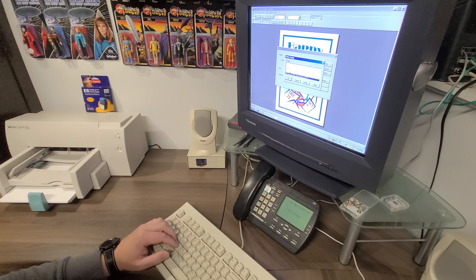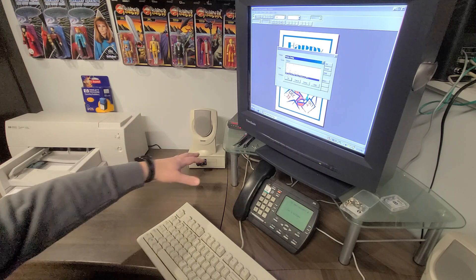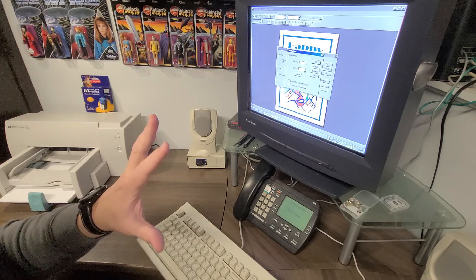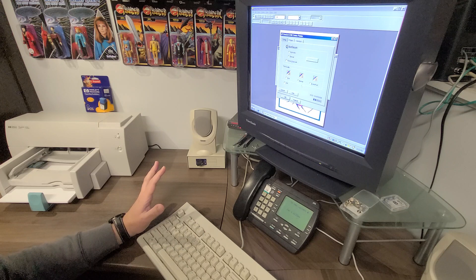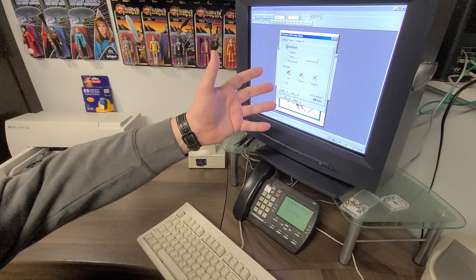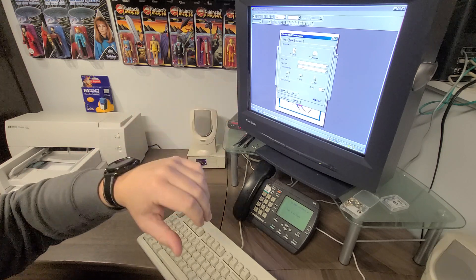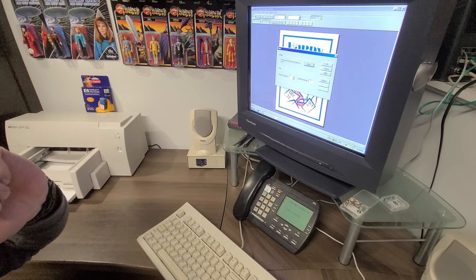I'm going to go ahead and choose the DeskJet 670C. I do have an LPT printer switcher device, so both printers are running through this at the moment. I'll hit OK so the computer recognizes where I want to print. I'm doing one copy. In terms of options, I'm not going to change any alignments — we're not doing anything super fancy. I can leave it on normal quality; there's also an EconoFast option which is more of an ink-saving option that's also faster. I'm going to do automatic normal print. Paper is letter 8.5x11, plain paper. I'll hit OK and then OK again to print.